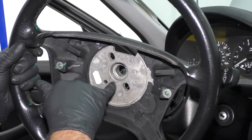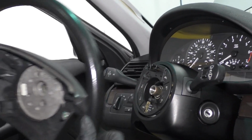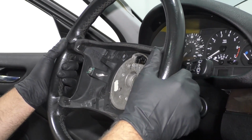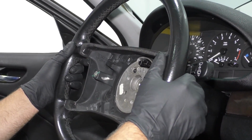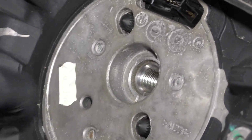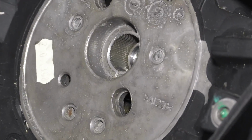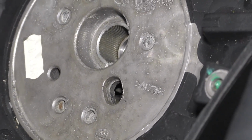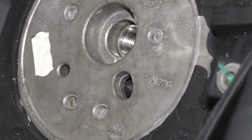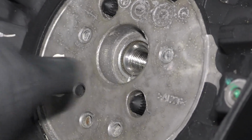Take the steering wheel. Remember, we want to line this line up for the base of the column right there. Might have to wiggle this a little bit. So look, if you look at it right now, I could put the steering wheel on like that, but that's actually wrong. What I have to do is slide it up, just move it over one tooth, wiggle that. So make sure you set that right there. Then we can take the bolt, install the bolt.